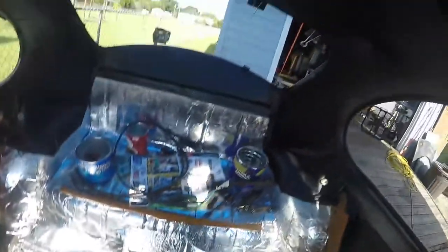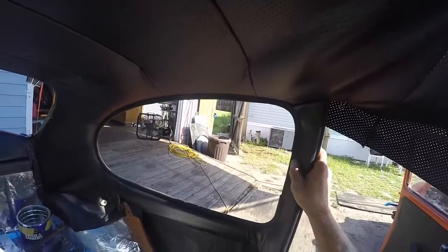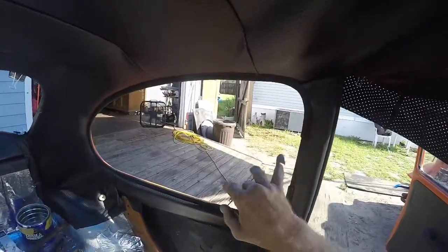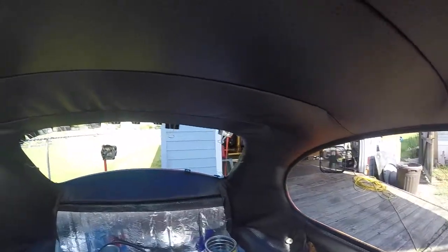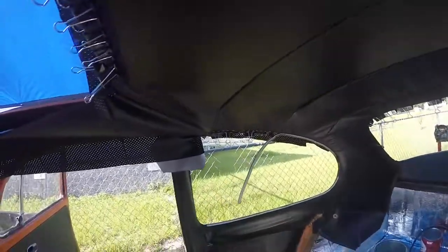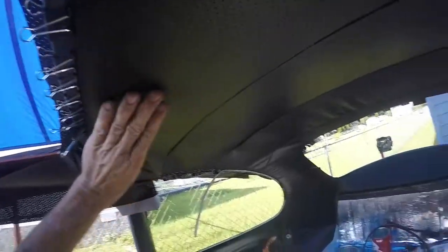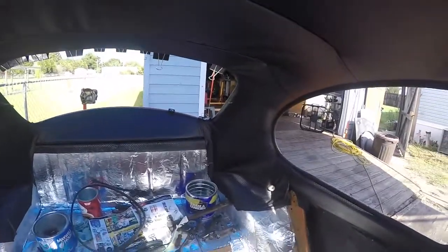All right guys, I'm back on the headliner today. We've had a lot of rain interrupting my days. I went ahead and put in the seal for the pop-out window and punched out my holes to locate them. I want to tighten up this corner a little bit and pull it back carefully to get the wrinkles out. I went ahead and cut out a small hole to start getting it tight to this corner, and of course that'll be lapped underneath. It's a very difficult job.